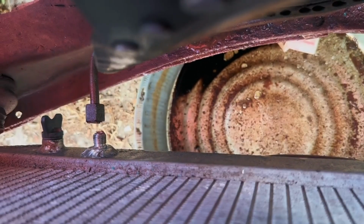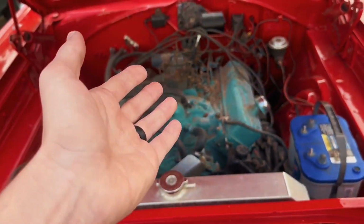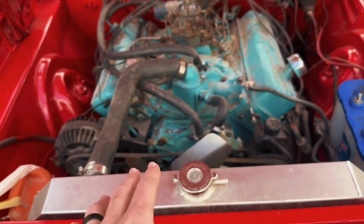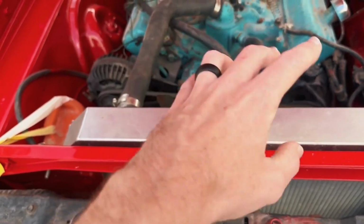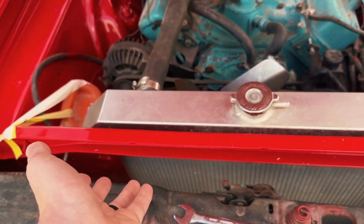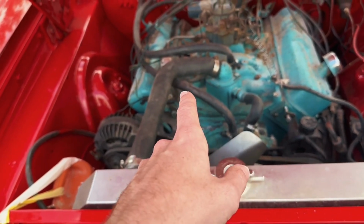The good news is, this whole engine and transmission are just temporary anyway, right? So instead of trying to get a whole new expensive radiator, we've decided that we just wanted to get a little external trans cooler for now, bypass that altogether at the bottom of the radiator, and just run a standalone cooler. That should get us on the road more quickly and more cost effectively.